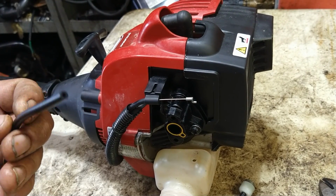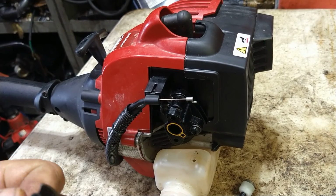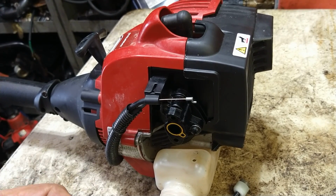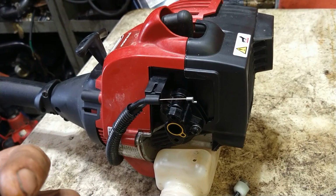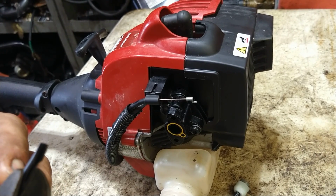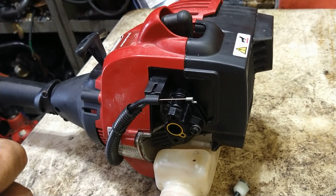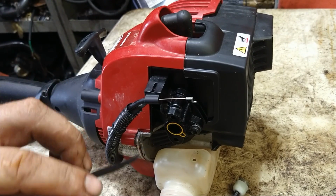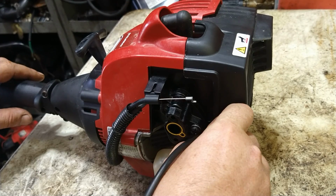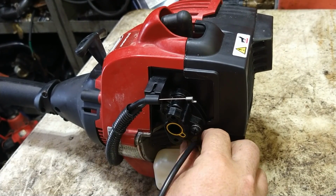This is going to be our fuel line, the one that takes the filter, the main fuel line, the inward fuel line, I guess. Cut a point in it. It'll make it easier. Cut the point very long, you know, just take half the fuel line off for a good section. Like that, and then you push it down into the hole. You can get it in there deeper. Let me get this thing started here, where you can reach it.